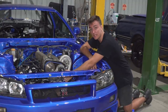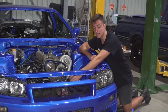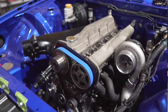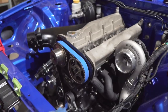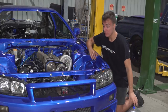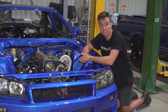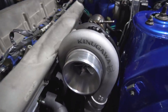Next up, moving down, we're going to be talking about the turbo exhaust manifold. Obviously it's aftermarket since the turbo is sitting up here instead of being low mounted like from factory. This is something I really, really advise not to cheap out on for multiple reasons we're going to get to. This one is specifically made by Six Boost — I'm pretty certain they're made in Australia from steam pipe, and they're an equal length runner design. It was $900, brand new, came in the box. A guy that follows the show didn't end up using it on his R34 Skyline project, so I ended up picking it up for a couple hundred bucks cheaper than what they are online, which is great.